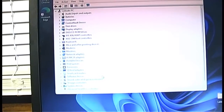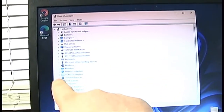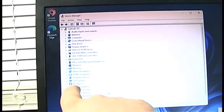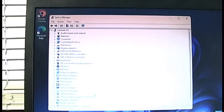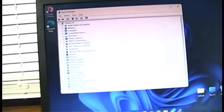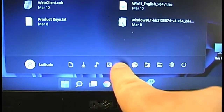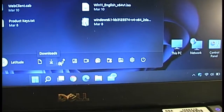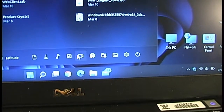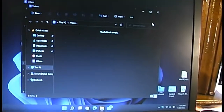You can see everything is installed and working correctly under Device Manager. When you first upgrade to Windows 11 on this machine, it's going to show a bunch of devices with exclamation marks because there are no Windows-supplied default drivers — you have to install those Dell programs to get them working. I also added all the user folders back to the Start menu, just like in Windows 7, so you can get to Downloads, Music, Pictures, Videos, and the like with a single click.